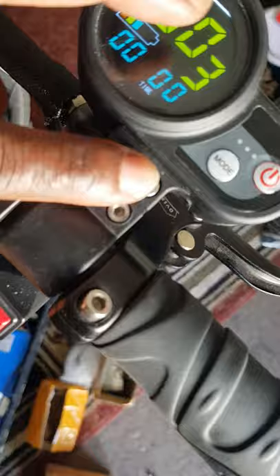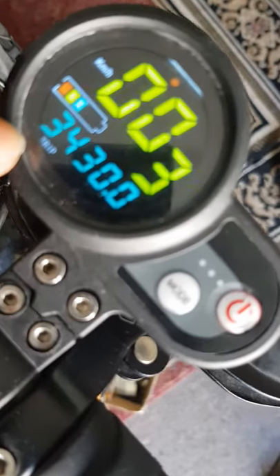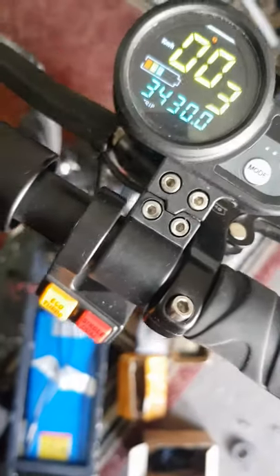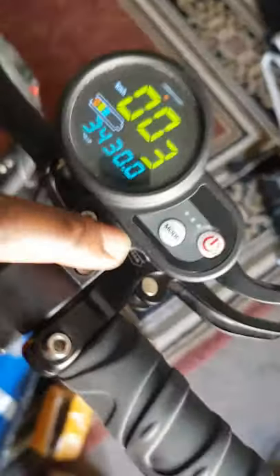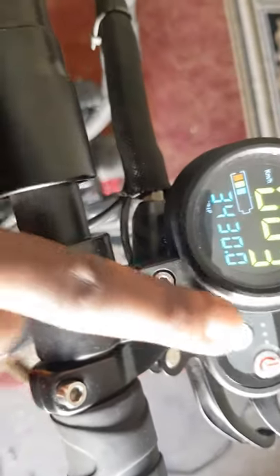So I know it might be the controller, the tail light system, or the accelerator. The first thing is usually the controller because these other parts don't go bad often. On this scooter, since I've had it I've done three thousand, four hundred and thirty kilometers — almost about three thousand miles on this scooter, which is amazing. Before I started having this problem. That's the thing when you buy a quality one like this, you might not have a big problem. The throttle body might be gone — they have electrical circuits, transistors, and resistors inside — electrical things do fail sometimes.